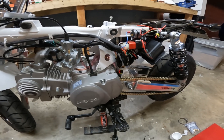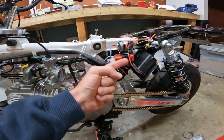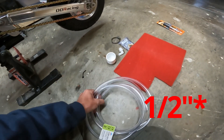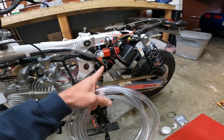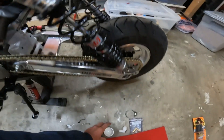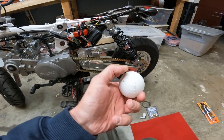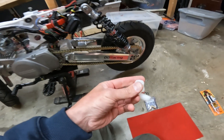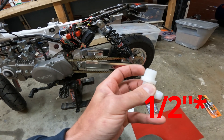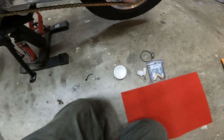What we need to do is run a tube from the vent upward. To do that, I bought some one-inch ID plastic tubing and I'm going to run it toward the back. Once I get to the back, I have a one-and-a-half inch PVC plumbing cap — I'm going to drill a hole in the bottom and use epoxy to attach a 90-degree one-inch fitting right into the bottom of the cap.